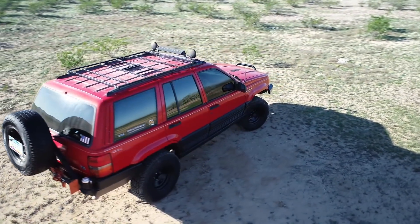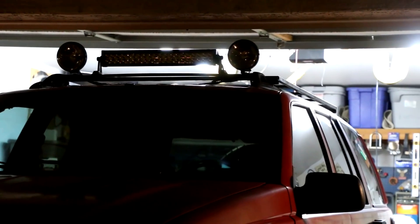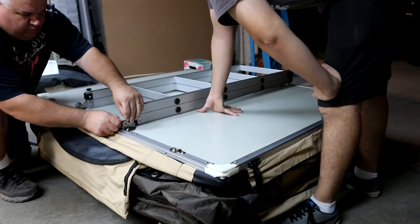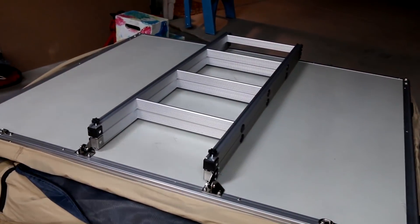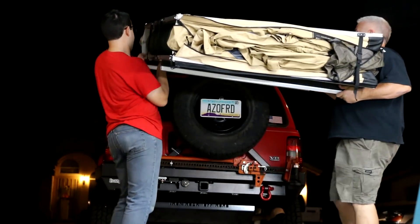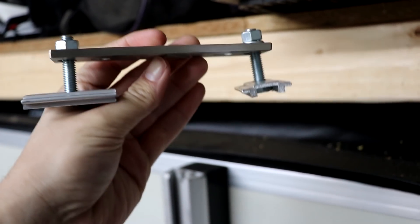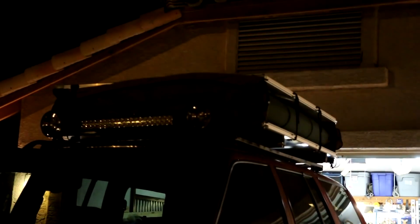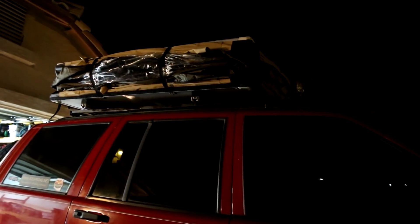Now that the rack was 100% done it was time to finish the final assembly of the tent and put it up for a test fit. We put the ladder on the top part of the tent base and quickly installed it using a few bolts and spacers. The ladder would be adjusted based on the height of the vehicle later, but it's what's used to help open and close the tent and hold the tent up after it is deployed — so getting it at the right angle and length is really critical. After this step it was time to lift this heavy thing up and onto the roof rack. After awkwardly getting the tent onto the Jeep we carefully positioned it and used the provided mounts to secure it, and during transit a travel cover would go on to help keep everything dry and strapped down.